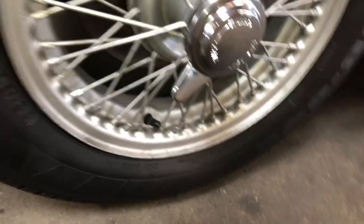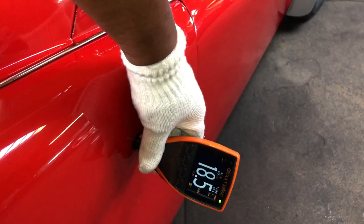Looks good. Always check the spokes here. Tire size is a 165/80 R15. DOT numbers run here somewhere — it's not one that I can decode. Quick shot of the wheel well area. I just try to get as many angles as possible. Back out again, and then just some light scuffs there. Let's get some fender readings — eighteen and a half, 21, 19 — so body filler down here, maybe a little thicker down there too where I'm not getting a full reading. Glass here on this side, good. No obvious chips, cracks, or signs of delamination.